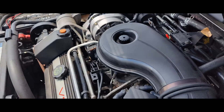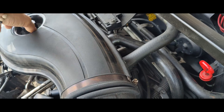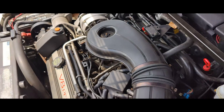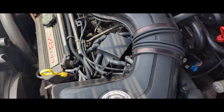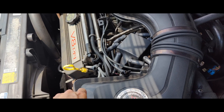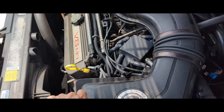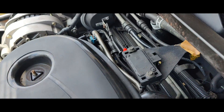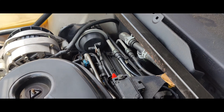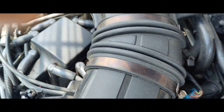Because of how easy these fuel lines look to get to, I think I'm just going to pull the intake off and check our fuel flow, because that definitely felt like it had no fuel. If you give it gas and it just sits there making that noise and doesn't sound happy — it sounds like a really, really lean motor. Wait, is this all quick connect? It is! This is going to be even easier. Let me put these screws back on — we won't even have to take this intake off.